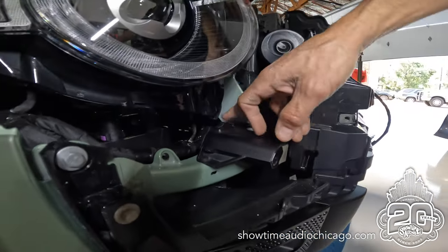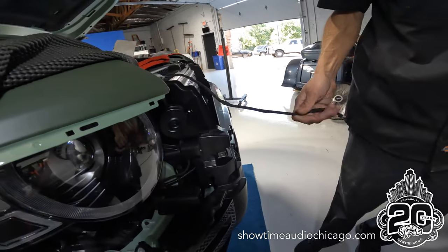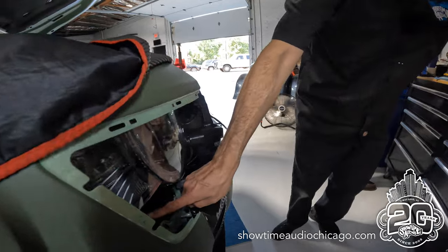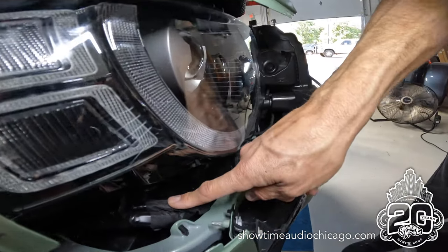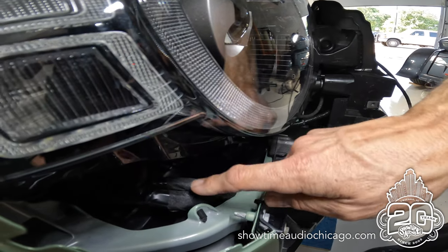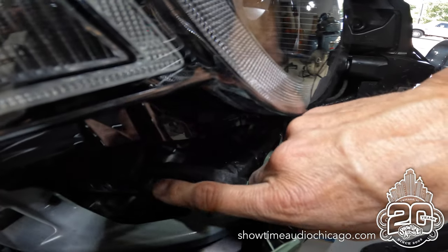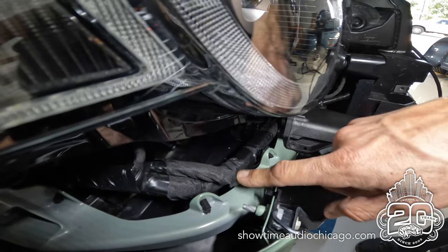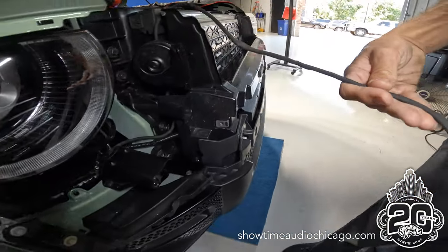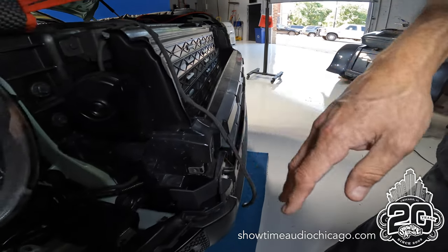We route all our wiring, and all our wiring is wrapped in this abrasion-resistant Tessa tape. This is a European tape used by a lot of the manufacturers to protect their wiring. It's abrasion-resistant, so it protects the wiring if it rubs up against any of the body panels or metal. If you look closely, there's the normal vinyl tape, and then there's the abrasion-resistant tape wherever it could make contact with something. We wrap all our connections in this abrasion-resistant tape to keep them from getting damaged so that the install will last forever.